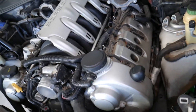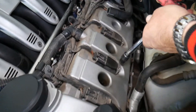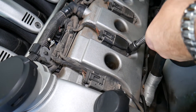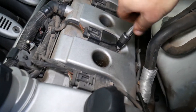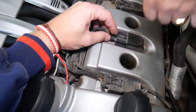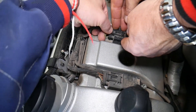Let's say we have a bad ignition coil on cylinder number six. We get a reverse Torx socket and remove the bolt that holds the ignition coil. You can see there's an oil leak here — you may even have oil inside the spark plug well, which is caused by the valve cover gasket. We'll definitely be fixing that next. Once that bolt comes out, push the connector down and disconnect it, being careful not to pull on the wires.